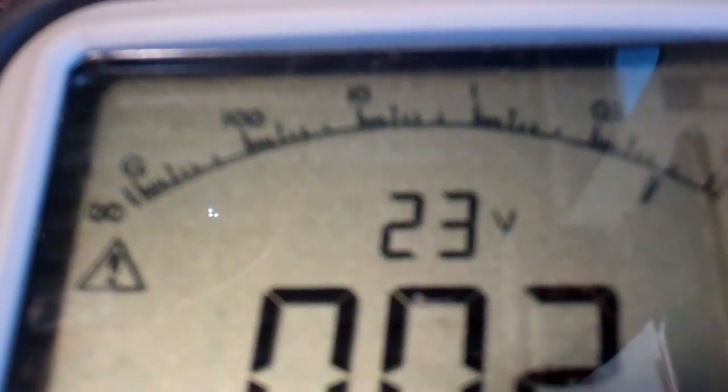0.02 - well that is the fan motor to neutral. That's the fan motor to live, so the fan motor is shorted out. That could be in here, so we'll take that off. We'll take the water off of there as well - the whole thing's been carried in water. That's live onto the unit - it's a bit better but it's not good. So we've definitely got a problem with the fan motor, or another problem on the unit somewhere, so we'll take a few more things off.